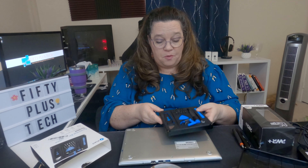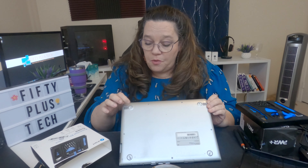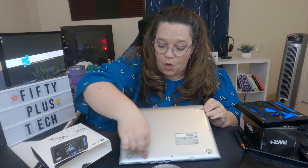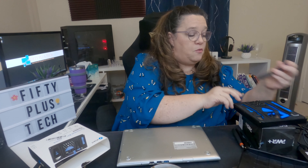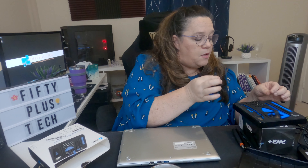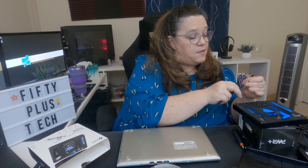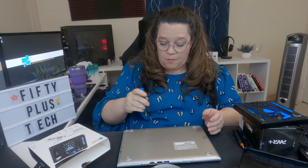The first thing we want to do is take out all the screws. There's a screw here, here, here, here, here, here, here, and here. You can use the iFixit kit — I think it's about $25 for the 80-bit kit — and get the correct size tiny little Phillips screw bit. Then just unscrew them all. And this is why I like the magnetic screwdriver: I basically put the screws separated in the bowl.